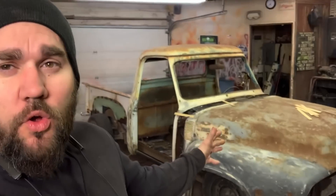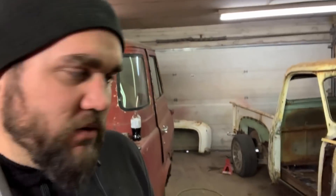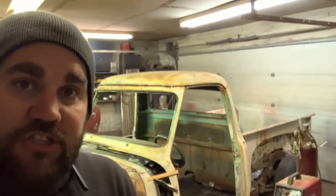Here's a tip for anybody that is doing a chassis swap — an old car or truck on a modern chassis. In my case I've got a 1954 Ford going on a 2000 Lincoln Town Car chassis, but it's the same principle either way. You would think: I've taken all these measurements, I know where this cab sat on the old frame, so I just need to make sure everything sits in relation to the same spot on the Lincoln frame. In reality, that means nothing because everything can be off a little bit. They built these old cars on an assembly line with no computers — they're not the most accurate. I've seen on a '50 Chevy where the wheelbase is supposed to be like 115 and I've seen it as low as 114 — a full inch off. So it happens.